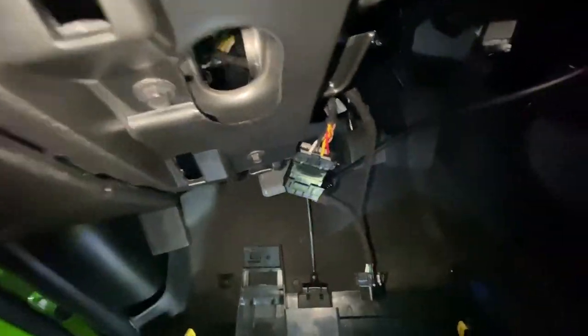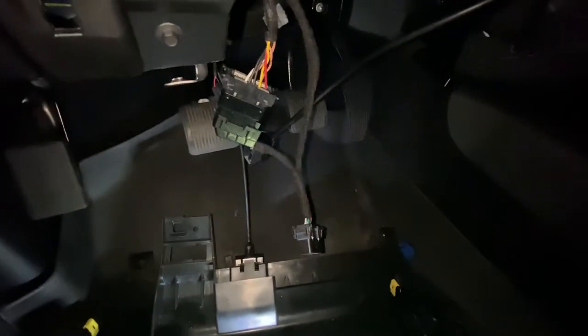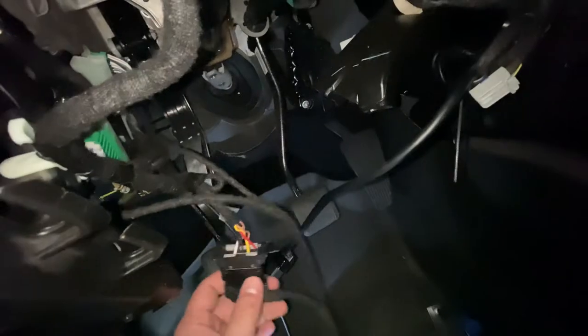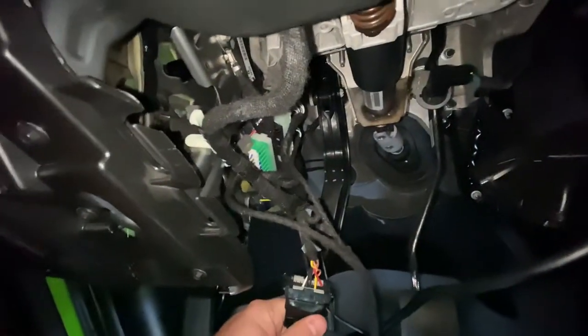I'm only going to put this kick panel back on because I'm not going to leave this hooked up since I have my EasyLink. But this is all you need to do to have the new bypass cable for your link. If you want to leave it on there, it's perfectly fine. I'm going to make all my changes first, then unhook it, plug the factory OBD back in, and leave the factory OBD2 still remaining and easy to use. Subscribe — we're going to have a lot more videos coming up showing features you can change on your RAM 1500, 2500, or 3500. If you have an 18 or 19 you will need this bypass cable; if you have a 13 to 17, it's not necessary. Thanks for stopping by.